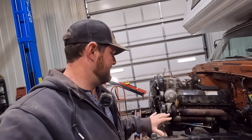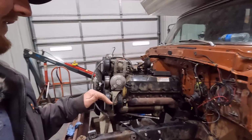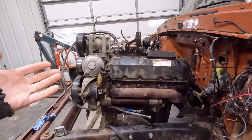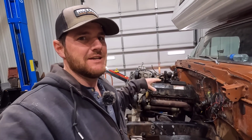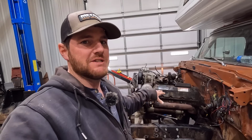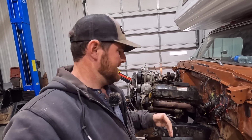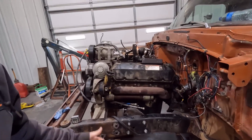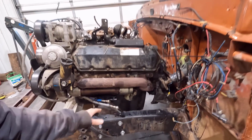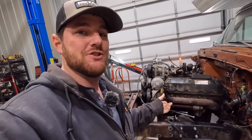So what we did was we verified everything. We did a bunch of checks to make sure everything's right on my end. We measured everything. We checked the angle of the engine to make sure it was perfect for what they designed it for. And basically what we came down to was we think the engine they scanned with the 3D scanner had old, worn out, busted out motor mounts, and this driver's side one must have been in the wrong position when they scanned it, because it was tilted this way and kind of like this. So we're going to try a new motor mount. Hopefully they designed one, and I took a bunch of pictures and measurements and sent it to them. So we're going to give it another try, a version 2.